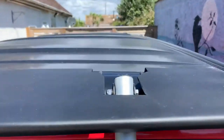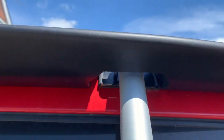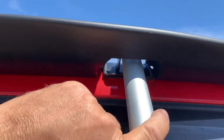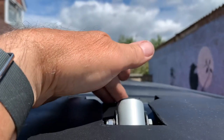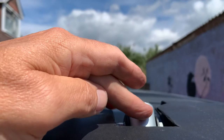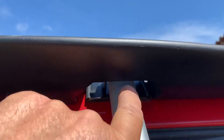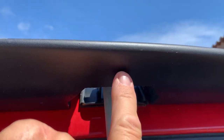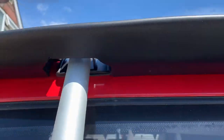There's loads of cutting involved. You've got to leave enough room because when you push this up to unhook it off the top of the tailgate, this bit here comes up. You need to make sure you leave enough room here because it will move up about three or four millimetres, so just make sure you've got enough clearance.